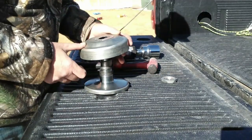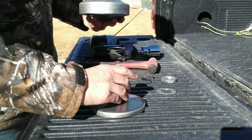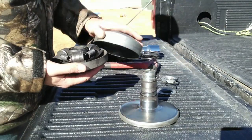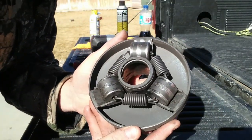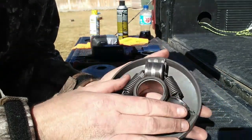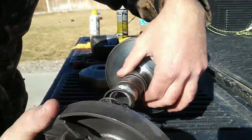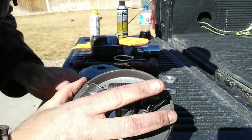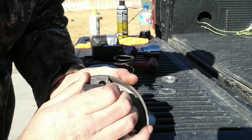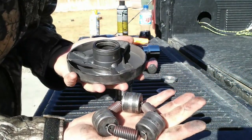Be careful, it's spring loaded — did you see that? Get the washer and everything off there. There's that spring. There's the front face plate. So inside there you have your springs and your weights. As that motor spins and this spins along with it, these weights climb a ramp, and that's what causes these two pieces here to move towards each other, squeezing that belt. So what I'm going to do is pull these out, just like so, and we'll give this a good cleaning.